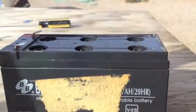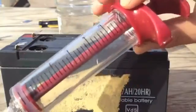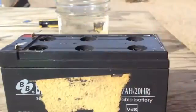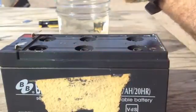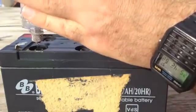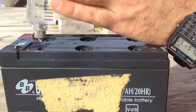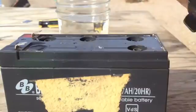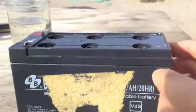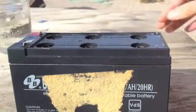You can see we got all the caps off, and it's time to start refilling these cells with water. I have a little cup of rain water here, and I like this meat syringe — you can buy these at Walmart and big box stores. I took off the metal syringe tip and just have its own little screw-on thing. I just stick it in the cup, fill the syringe, and put it right over each cell, and you can fill fast. This battery is so dry it's going to take between 20 and 30 milliliters per cell — it just took an entire syringe on that first cell. A dry battery can take just about one full syringe, which is 30 milliliters. I went ahead and filled all six cells — it took about a third of a pint of this mason jar of rain water. Now it's time to charge it up.